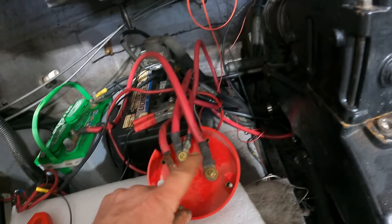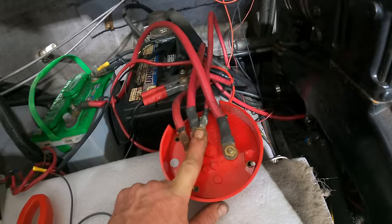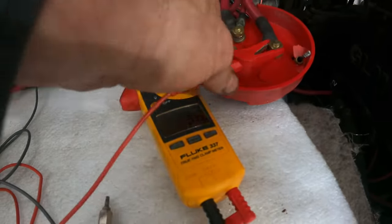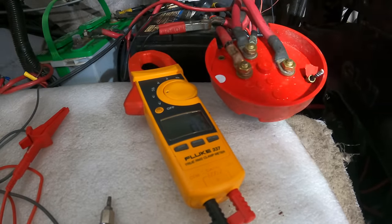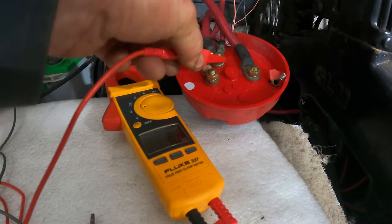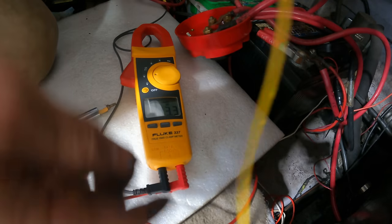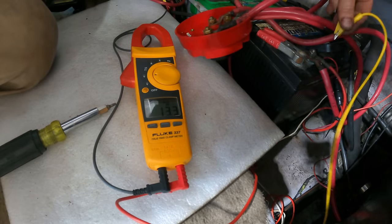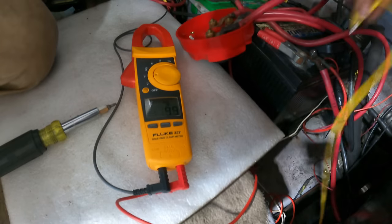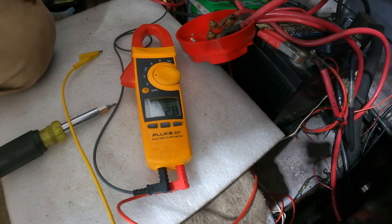This is one battery in, this is the other battery in. This is the wire going out to the starter. So let me summarize a little troubleshooting here. I'm checking the voltage on each individual battery, and the black battery on the right, as you're seeing it, has 13.3 volts. It is definitely the better battery. Earlier when I checked the voltage at the batteries, it only dropped to like 11, 11.5. Now I'm checking it at the starter. Let's crank it and see what it does. It goes straight to 9 and then it hits that bad spot on the flywheel.